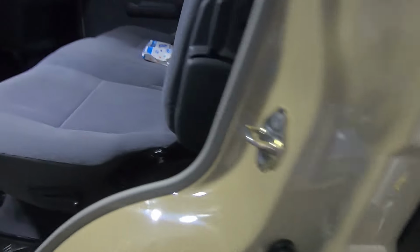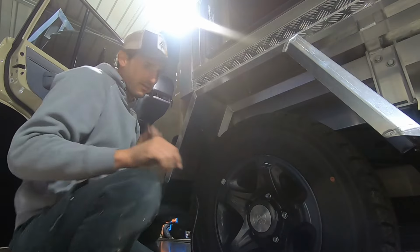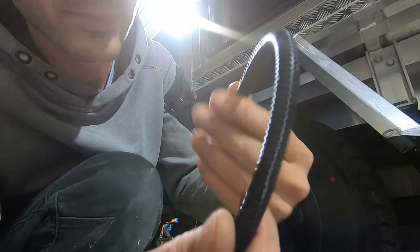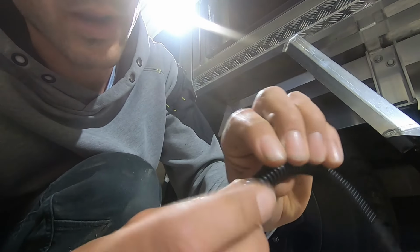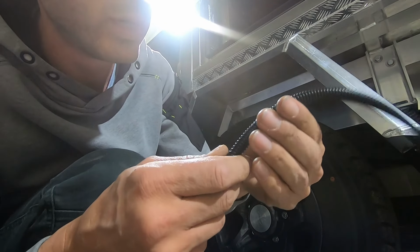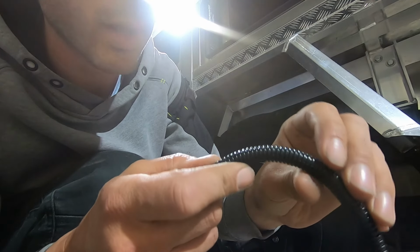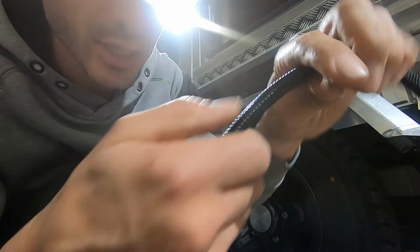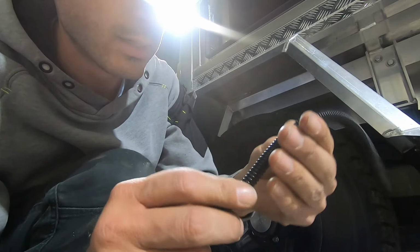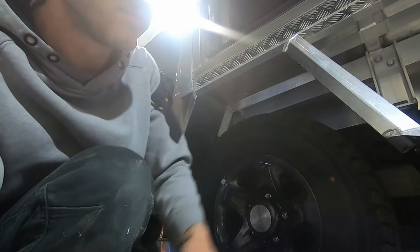Ace Ventura vibes. Alright. Now, I don't know if it helps. The cable, obviously this sheath has a split on one side, so you get the wire in there. So make the split at the bottom where it comes through the back wall. So if there's any water, I suppose, it's not going to get inside the actual sheath and run its way into the car. So I don't know, maybe I'm just overlooking it, but upside down sort of makes sense.